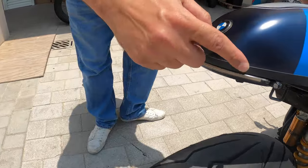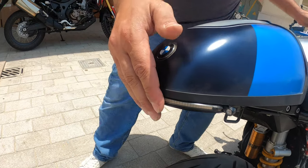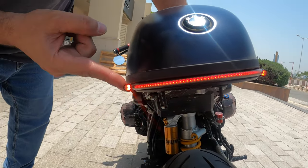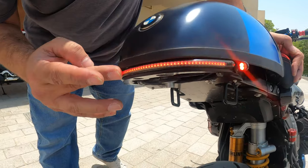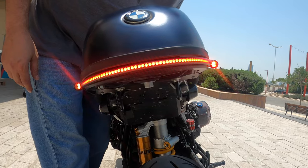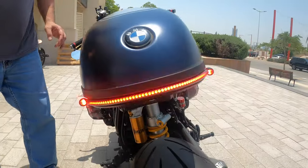This is a combination of two companies. Daedalus, out of California, makes extremely nice tail lights, and the two small ones here are triple-function indicators from Kellermann — we integrated both together to give a stronger light. This has a rear light, brake light, and indicator. When you press the brake, the whole thing lights up, and for the indicator, half goes on while the other half goes off.